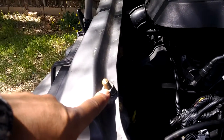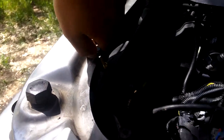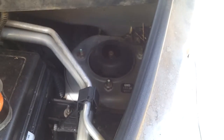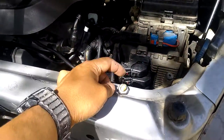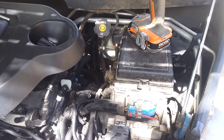Just be careful — read your manual or do your research. The majority of cars, the body is negative or black. If for any reason this sticks out too far to where it'll hit on the hood, just get an angle grinder and grind it down, and you should be good. There's your negative lug — now a lot easier than using this crap. Thanks Chevrolet — 'find new roads,' huh? Yeah, new roads to a tow truck or a mechanic shop. I hope this helps you guys out; maybe this will make your life easier if you want to jump somebody or they want to give you a jump.